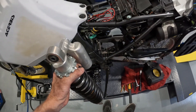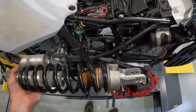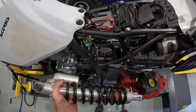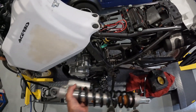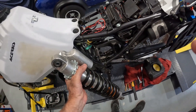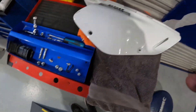Remember to remove your locking collars before taking the shock out, because it's a lot easier to work with when it's locked on the bike rather than in the vice. You just pull the locking collar off at the bottom, take the spring off, and I'll send it away for new valving and an 8.5 kilogram per millimetre spring rate. That's the rear shock done. Once I get this back, I'll then get to the front shocks. Getting it out was easy - getting it back in will be the hard bit.